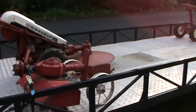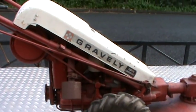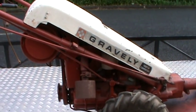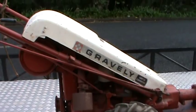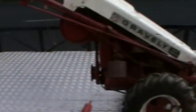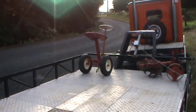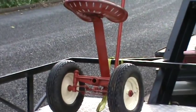I've normally got a flat tire on my trailer. It won't start because of low compression. Normally it's an exhaust valve on these old things — they sit with the exhaust valve open and it gets pitted. It's got a good magneto, good spark. So, Gravely fans, give a shout. I'm skinned.